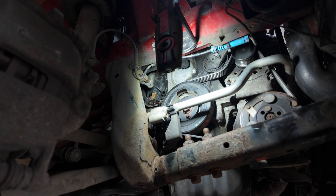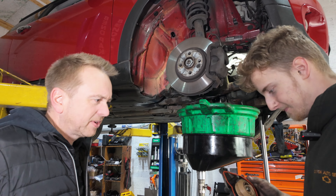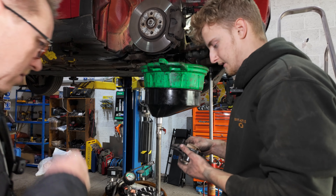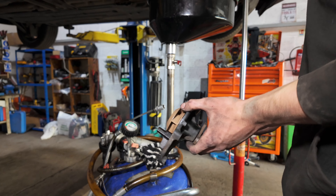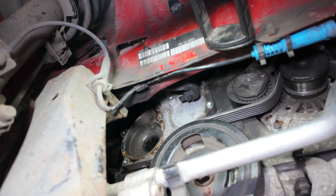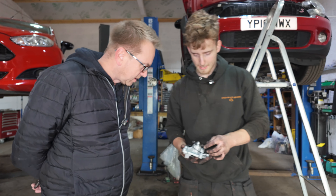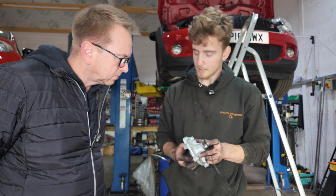The car's taking a pee — there we go, that's where it was leaking from. A lot of these have a little core plug in them, so that if the water pump starts to fail that'll go first and just leak straight down. If you look up there you'll see the big old hole in the side of the block. That's the old one — a bit of plastic. The whole thing's plastic apart from where the pulley mounts on. The impeller's plastic and the body's plastic. The new one is from a company called BGA — it's a full metal housing and a metal impeller. Happy days.